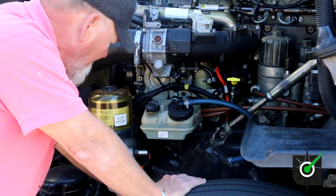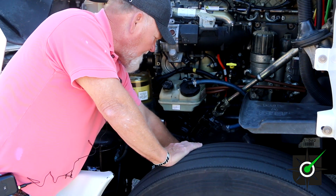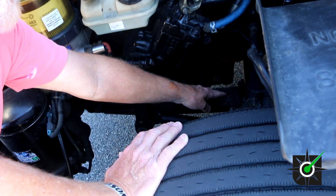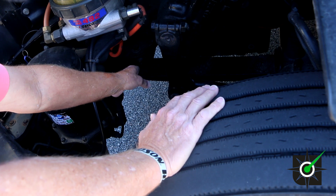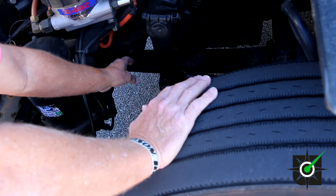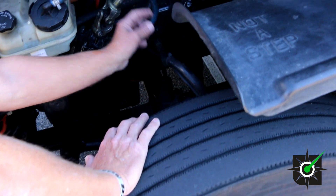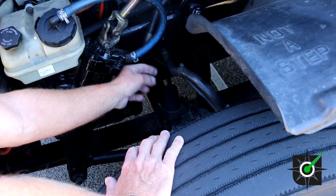We'll go inside to the suspension. We have leaf springs. The leaf springs are properly mounted and secure — they're not cracked, bent, or damaged. They're not shifted, they're properly aligned. They bolt on with U-bolts — the U-bolts are present and tight. The springs bolt on at front and rear mounts, and the bolts are tight. The mounts are properly mounted and secure, not bent, cracked, or damaged. From the spring to the shock — the shock bolts on at both ends, properly mounted and secure. It's not leaking — it's a hydraulic shock, so there would be trails of grease and oil on it if it was leaking.